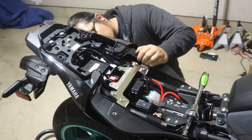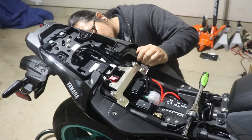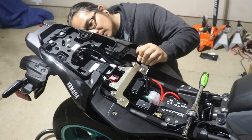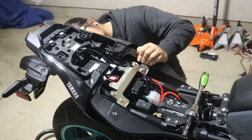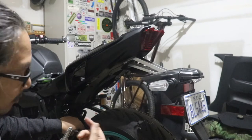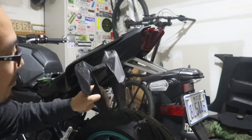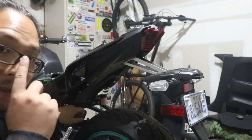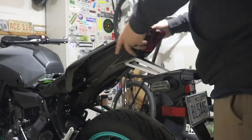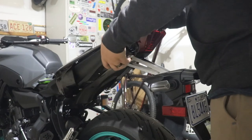You do need to get to these push pins — there are a bunch of different push pins. Just push in the center port to release them. Once you get rid of the push pins you can remove them. Then go to this plastic piece, remove it, and TST Industries includes plugs that will plug those holes. With all those removed you should be able to separate the tail section.